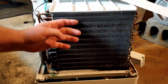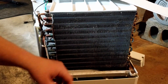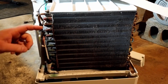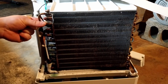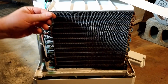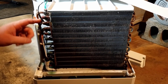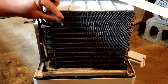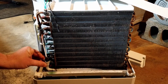The warm water from the air will collect on it, drip down, and remove the frost. This is a little sensor right here that detects ice buildup. The problem with most dehumidifiers is that the location of this sensor is usually the dumbest spot imaginable. This is your ice sensor — it's basically a thermistor. The problem is, with it being way out on the edge, it's probably one of the last locations to actually ice, especially when it starts getting cold down here.